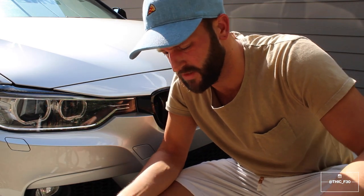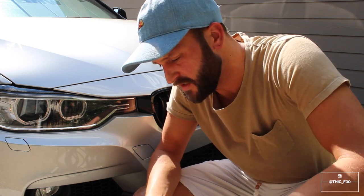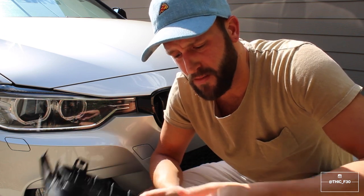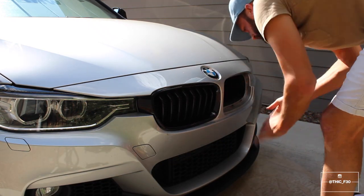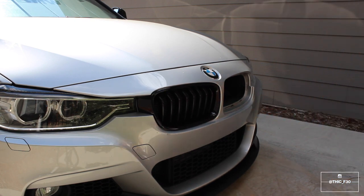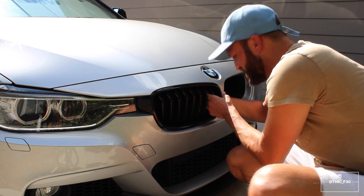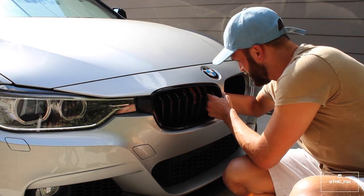It's really easy to remove. You don't need to take the bolts out of the top of the bumper and pull it back. You just got to sneak your hands in there, sneak your fingers in, and pop these little clips — just pull from below, pull up. Simple. Then once you take out one side you can put your hand in from the back; it's even easier.